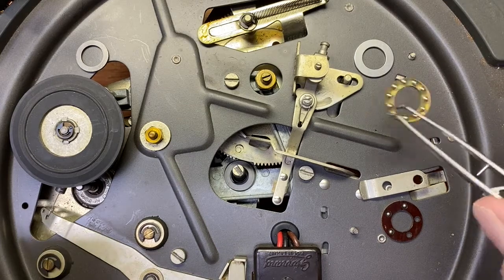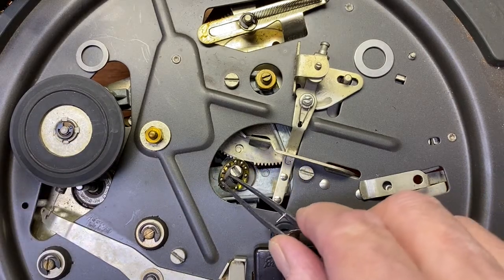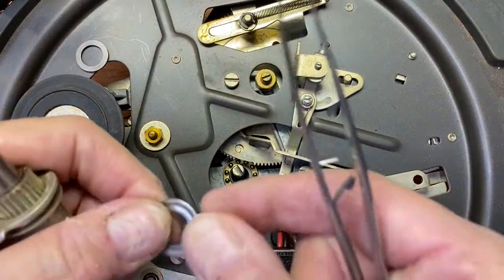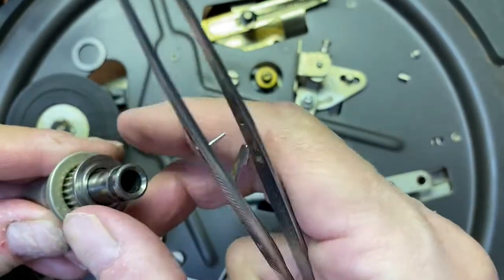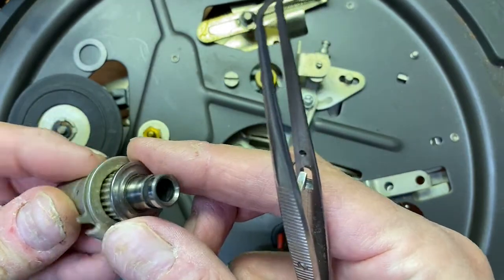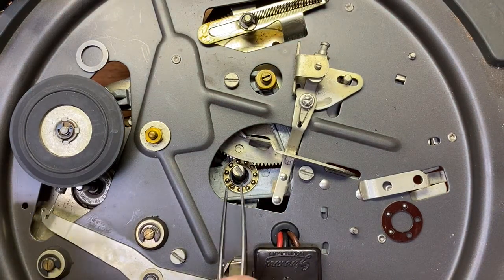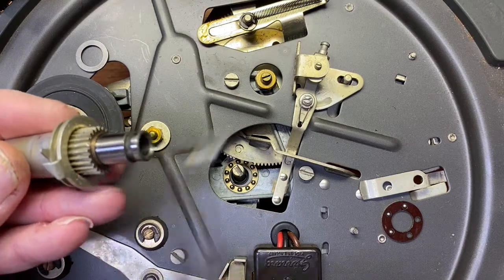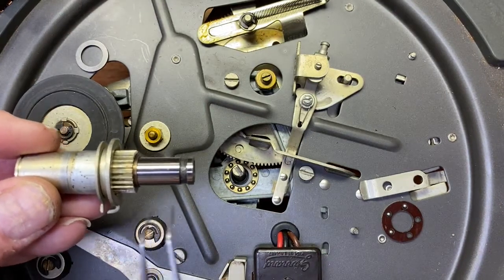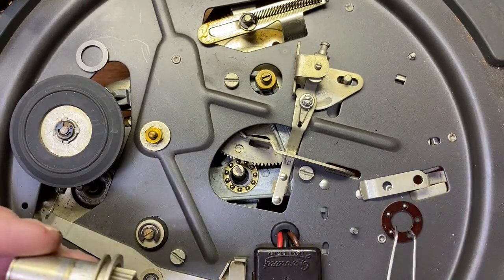And then you're going to put the new washer. Don't forget, that's loaded with lithium grease. You're going to drop that on there like that. You're then going to get the race washer, which, don't forget, is a perfect fit here, as you can see. And because it's a perfect fit, it keeps that guy in place. It's also less drag because the ball bearing does not touch the side of the rotating shaft. So less drag, more speed, more bearings, less rumble. It's all good.